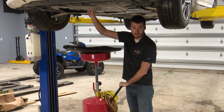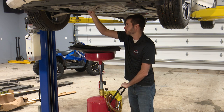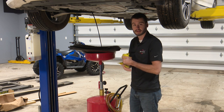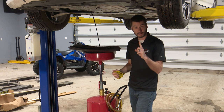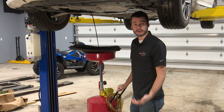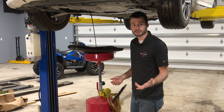Being a Honda, there is a drain plug gasket on here, so we'll be swapping that out as well to prevent any oil leaks. It's a 17-millimeter on this drain plug. I'm still running 5,000 miles on this oil in a hybrid. The maintenance minder on this car told me it needed an oil change at the 10,000-mile mark for the first one, and this thing had already had two oil changes at that point. Oil is the cheapest thing you can do to prevent replacing an engine — way cheaper to do than an engine.